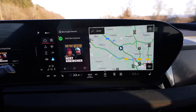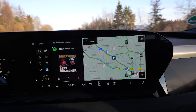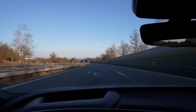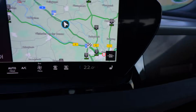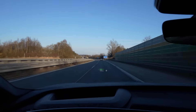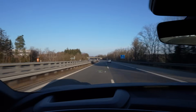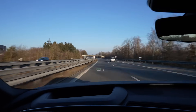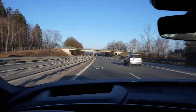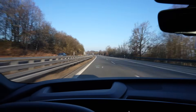I'm in eco mode. I'm trying it out — if it gets cold I'll come out of eco mode. Right now heat is at 22 degrees on auto, medium airflow, no seat heater. I had the heat on during charging so it didn't get cold in here. Efficiency mode is important not just for heat, but also because this car has air suspension — in eco mode the car lowers and becomes more aerodynamic. In individual mode you can also set the ride height manually.